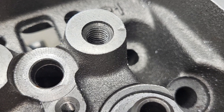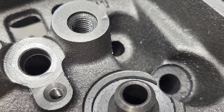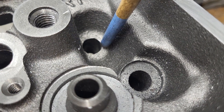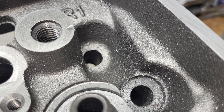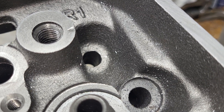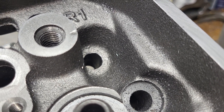Chevys usually don't have a big problem with drain-back, but small block Fords do. I've had problems with small block Fords and drain-back issues using a stock pan, a high-volume pump, and 7,000 RPM - it'll literally suck the pan dry, seize the pump, twist the shaft, and you'll burn all the bearings in the bottom. Ask me how I know.